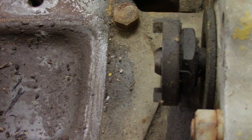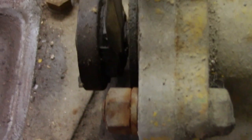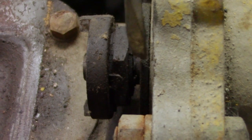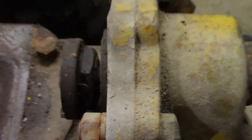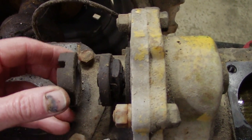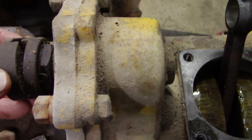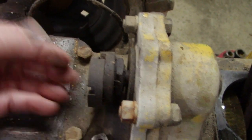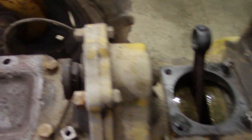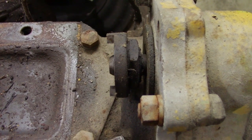That's the magneto-adjustable coupler. There's a flanged washer in there with teeth on it. You can see one of the teeth is bent out to keep it from moving. We have to take a screwdriver and unbend that tooth. The fiber washer goes on top of this. And then the magneto fits in from here into the fiber. Do these adjustments when you still have the fan blade on, so that you can put your pry bar in the fan blades to lock it in place.